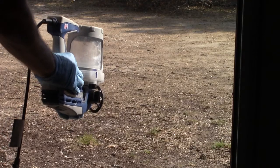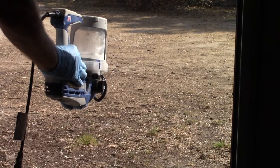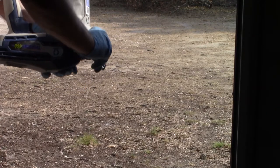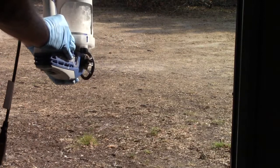With the sprayer inverted and the mode selector knob set to prime, pull the trigger for 5 to 10 seconds to put clean water through the pump. Then switch the knob to the spray position, rotate the tip 180 degrees to the unclogged position, and press the trigger for about 5 seconds. This should flush any remaining material out of the tip orifice.